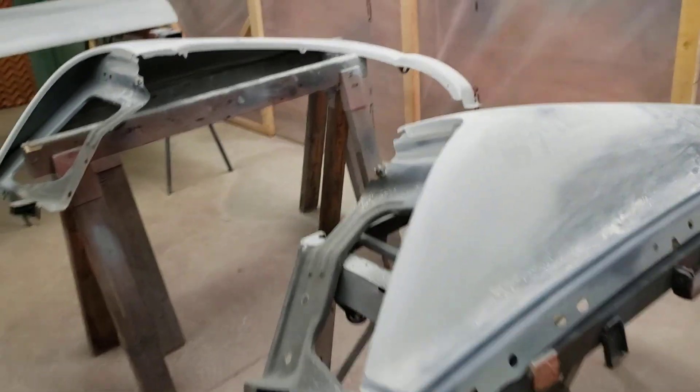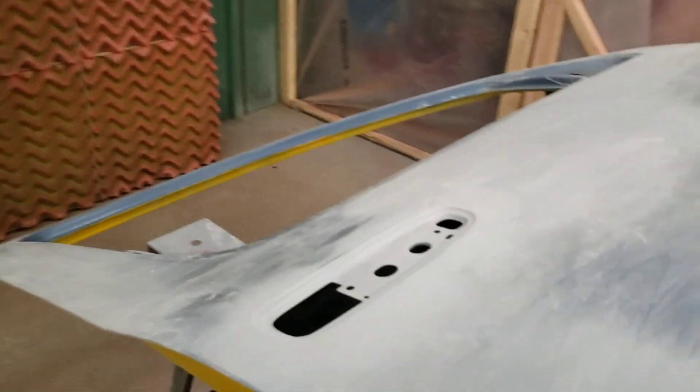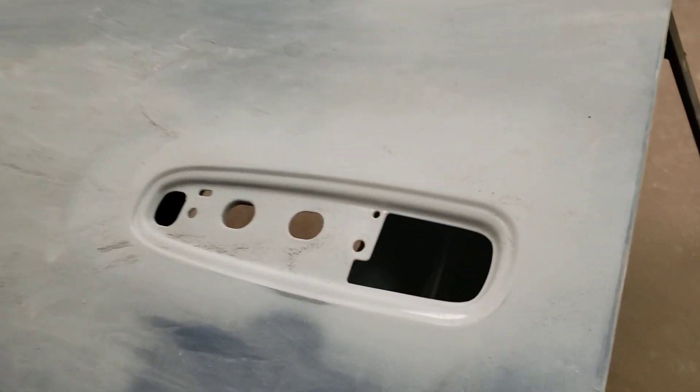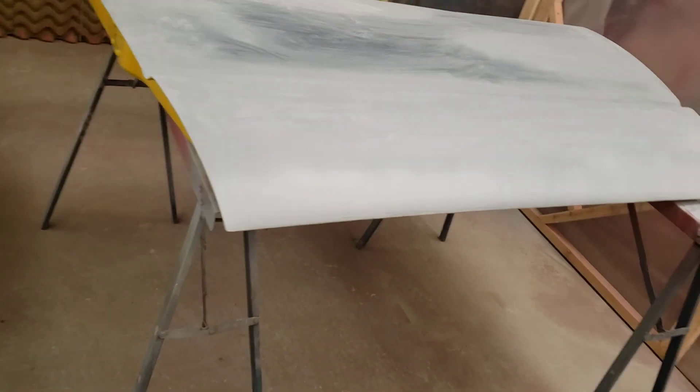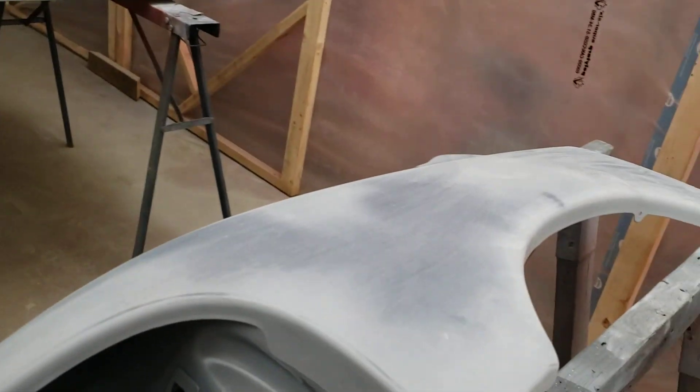It's the 05 Rumblebee. These are some of the parts — I just went over them and cleaned them up. There are a few places where we used a different kind of primer, but I went ahead with the epoxy primer. I basically shot around the handles and scuffed them because down the road that's a place where they tend to trip or chip off. And the door bottoms — you can see a little bit of a fog fade there, that's already been sanded. I went across the bottoms and the weak points because that stuff seems really good. Around the headlights — I got a chip here I got to fix, but otherwise these panels are all wash-and-shoot, they're ready to go.